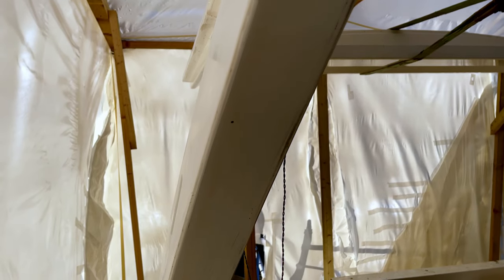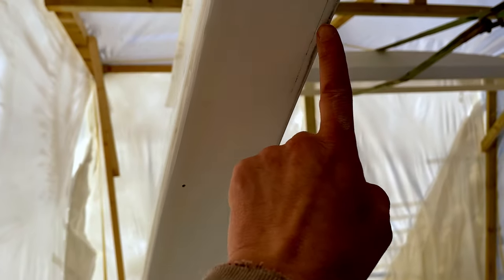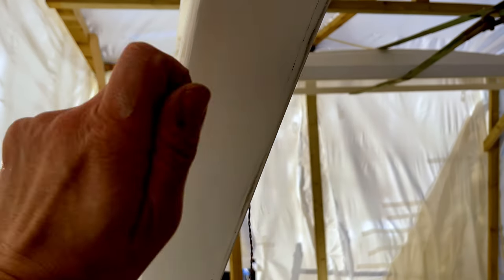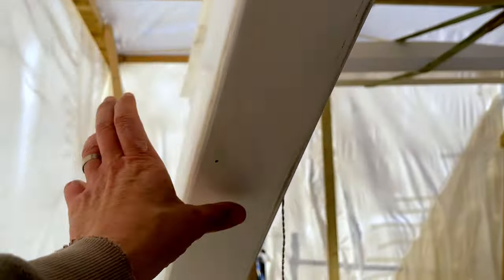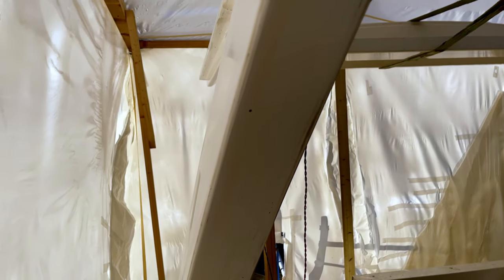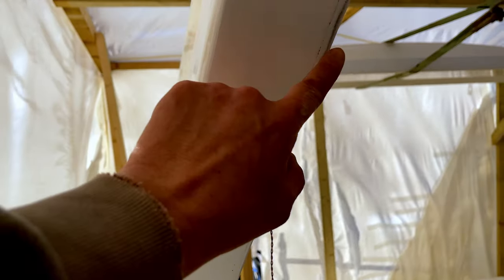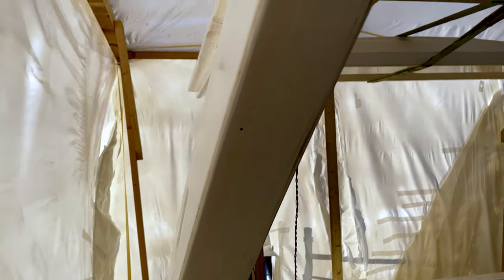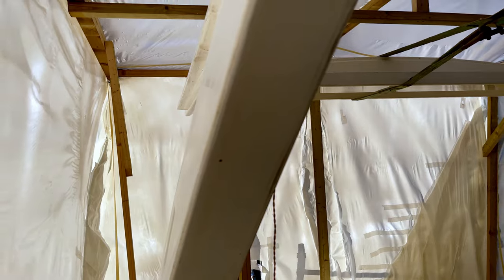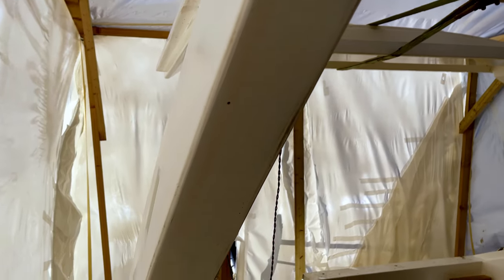This was actually painted with gel coat, probably at the factory. So there would be a joint just here, and they painted it with gel coat and it got brush marks in it. So we've just flattened those out, and we might need to gel coat it again, obviously, because we've just gone through a little bit here. It was already very thin there, so we'll gel coat it again and polish it. But that looks pretty good, or will come up really good.